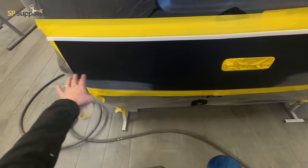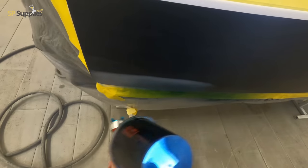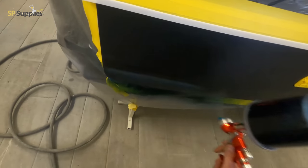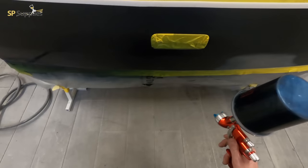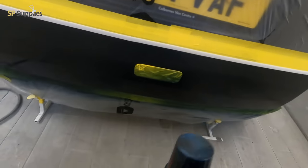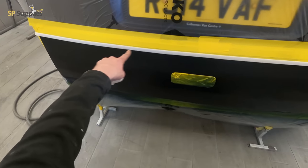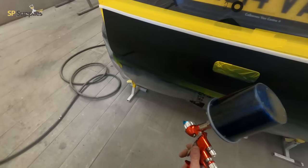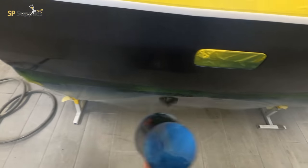We've got two little spots where we've just done UV primer, and we're going to try and keep the base coat to around about the level of where the handle is in the middle of the door. We want to keep the base coat away from that fade-out tape, because if any base coat hits that edge and we clear coat up to it, we're going to end up with a line. If it's just clear coat that hits that edge, we'll end up with a very light feathered edge — so keep it low in the middle and away from the tape at the top.